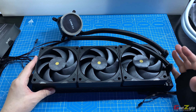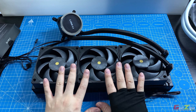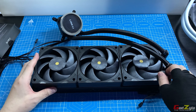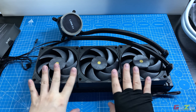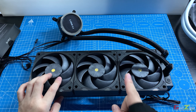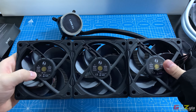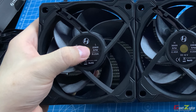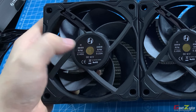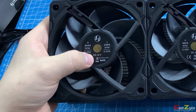The Galahad 2 Trinity Performance is the top-tier configuration. The fans come with a controller for high or low modes: low runs at 2,300 RPM drawing 0.23A, and high runs at 3,000 RPM drawing 0.45A. All fans run at 12V DC.